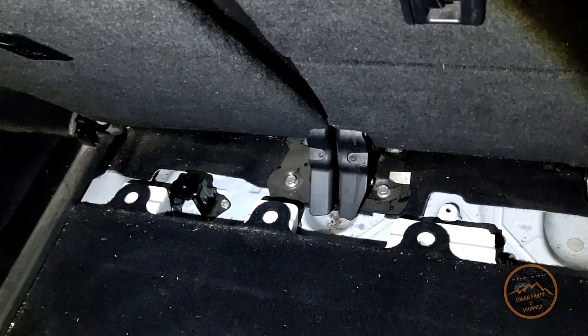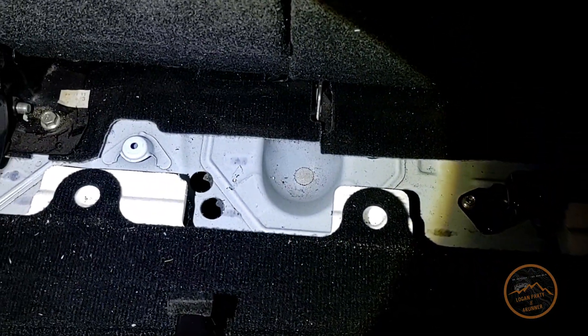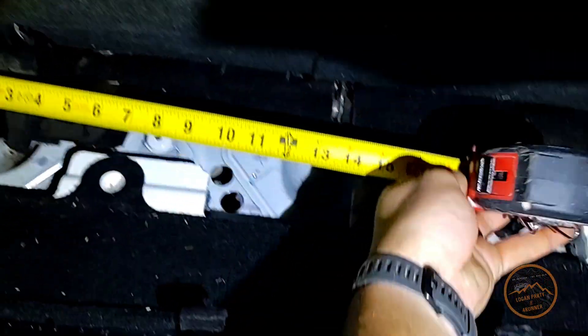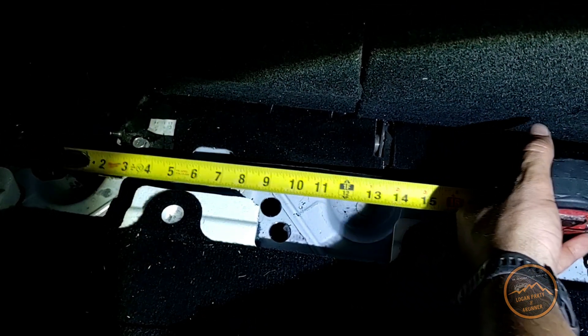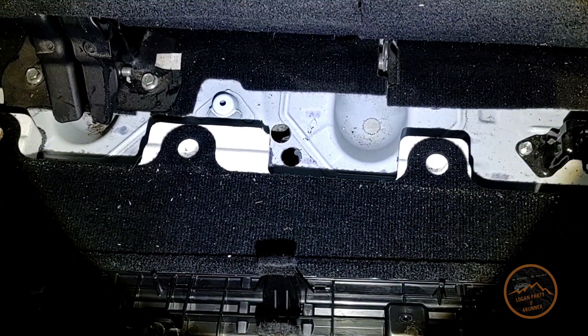Here's where I drilled the hole into the back. This is the back of the seats — there's a little trim piece that sits right there, held by two bolts at the anchor points. Take that out and this is what you see. I drilled my holes right there — it's a very good spot for access from underneath. For reference, measuring off the center post where the seat attaches, it's about nine inches from the anchor point on the rear seat to the right. Right in the middle there, you can get two holes and the grommet fits in there.